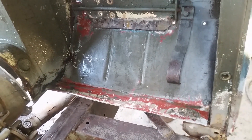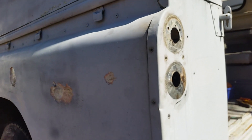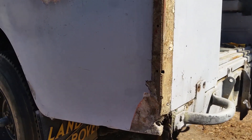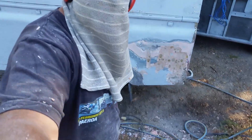However, I've got other rust to take care of. You can see where I've sandblasted in the bottom corners of the bulkhead and the rear corners where I've dug bog out. It was filled out to the line — something like half an inch thick. So I've undrilled the rivets on the cover. I'll take that off and panel beat that separately, but that will give me the line that this guard has to be brought out to. I've started grinding all of the bog out of here because I'm not satisfied.